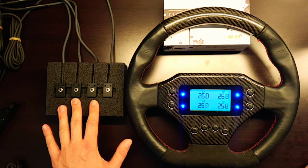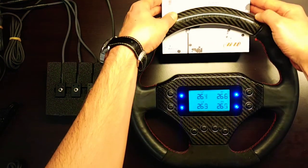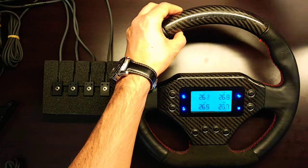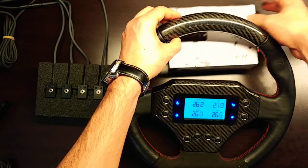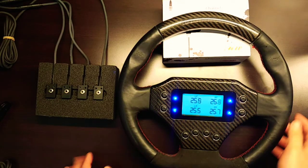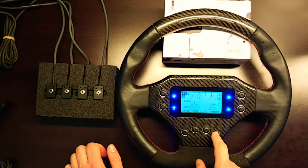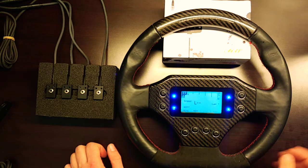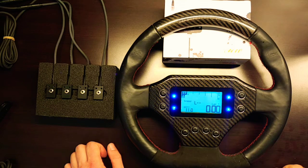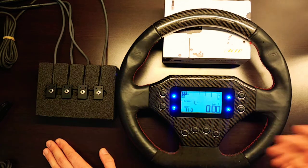The system is connected via a data hub and channel expansion — a simple analog channel expansion with the IR temp sensors and the EVO 4. This particular EVO 4 has been configured for K-Line communication via the ECU for Subaru applications. Scrolling back to the home screen, the unit will start displaying live values, and all four corner tire temperature alarms remain active even when not on the tire temp screen.